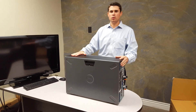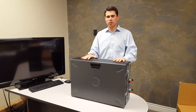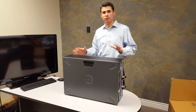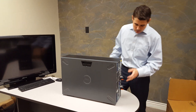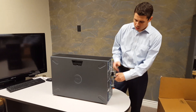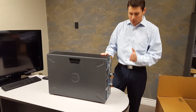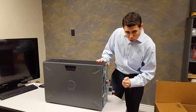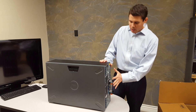When I pull it out I always do a quick visual check. I've actually seen servers come with dents in them, and I've seen motherboards get dislodged. I always like to make sure my power supplies come in and out real easy — they've got a little bit of a snap when they go in, and they should take a good pull to get them out.